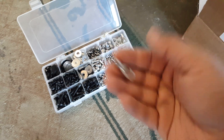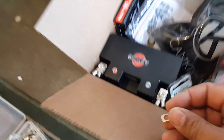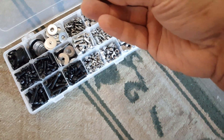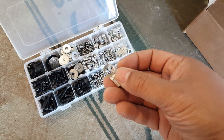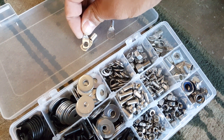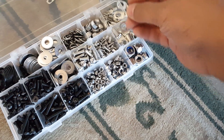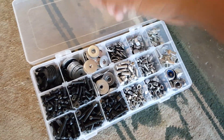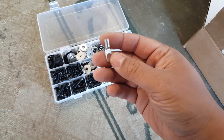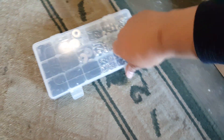This one is a little too big, so I used the one with a smaller hole because I don't want any slack rubbing against the terminal bolt. This one actually fits the terminal bolt just right — they're a little smaller compared to the bigger ones. You can see the difference here; they can almost swallow them in. I like a tight and secure fit — I don't want it wobbling even though it's bolted on. So I'll get a propane torch, heat some solder in there, then slide the wires in just like APM did in his video, and hopefully it stays there forever.